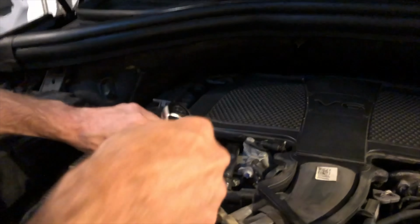All right, so you'll find it easier if you use this instead of a ratchet. So much easier. All right, so I used the driver tool with this T25 bit for this screw and for the one down here, and that was easiest. And then I used this ratchet with the T25 bit here and the one on the bottom. And then tweak them all with this one afterwards. This thing's very tight, ready to go, and now we're gonna put the air filter housing back on.